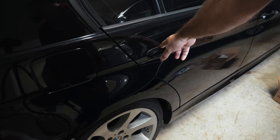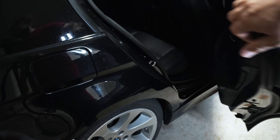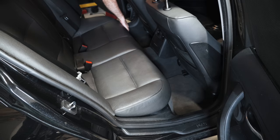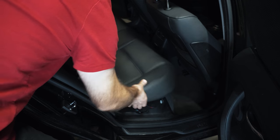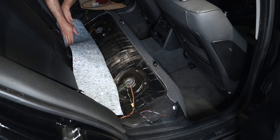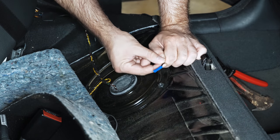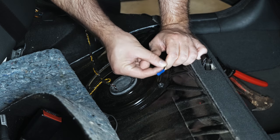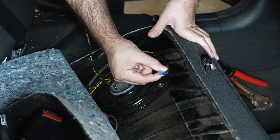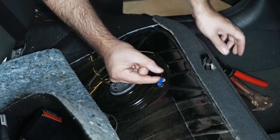Now that the HOB switch is run, I'm going to go into the back seat and lift up on the seat base so we can get access to the fuel pump. Here's the switch ground from the front of the car that's run up to that HOB switch, which is only active at 15 psi. This will ground the relay to allow the circuit to complete.